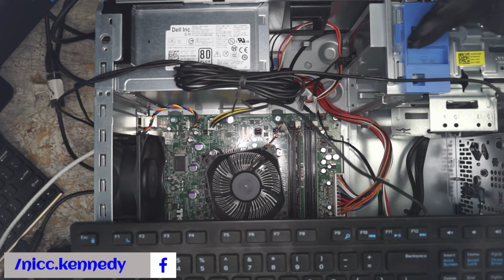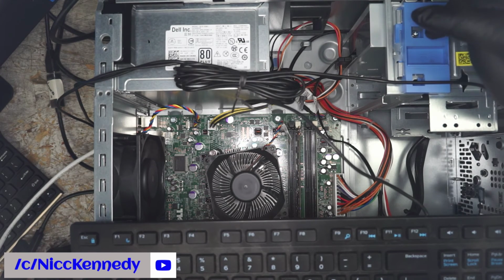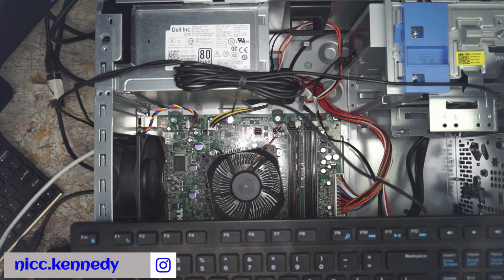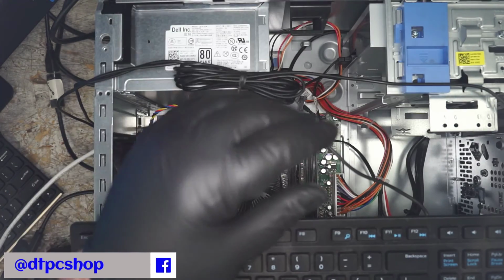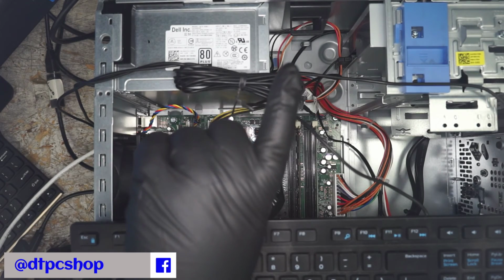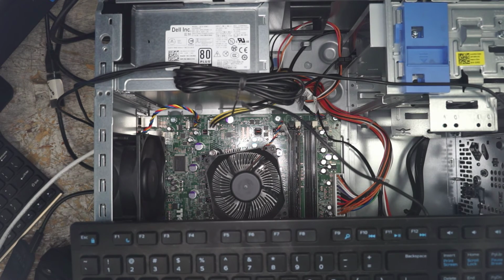When you are at the screen where it said unallocated space, you're going to want to delete any partitions that are there. You're going to have one for system, one for the OS, one reserved, which I think is your recovery, and then possibly one or two other partitions depending on the brand of your computer. Highlight all of them, then go down to the options at the bottom and click delete. Very, very easy. As you delete each partition, it all joins into one. When it's all one and says unallocated space, just click next, and your Windows 10 install will complete, and you're good to go.